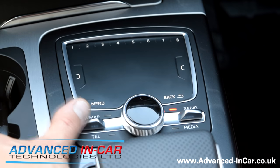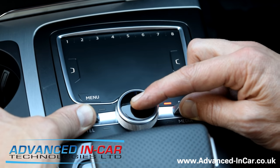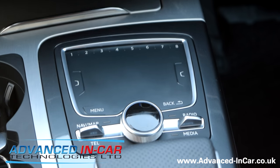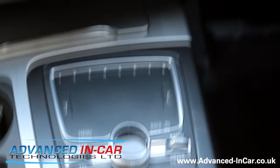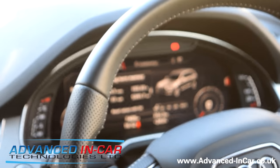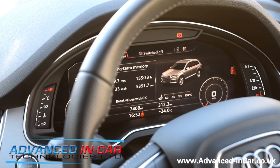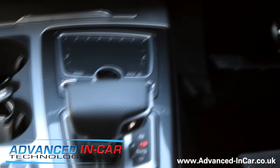Using the radio button and the nav button, you're going to simply push up, and at the same time you're going to push and hold the off button — the big MMI button. You'll see that the screen has gone off but won't go down, and then on the driver's information system it just says the word 'initializing' and then it'll say it's perhaps switched off. The screen doesn't do anything, so don't worry — as long as the screen physically goes off, you've done your MMI reset.